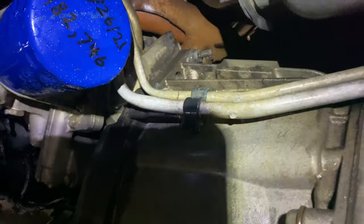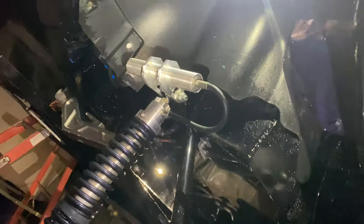Just to be 100% sure I'm going to go ahead and take out this driver's side fender well, because I've been leaking a lot of oil on the driver's side. I'll pull this fender well out so we can get a better look. Now I'm going to continue pulling this fender well out to see if I can figure out where that oil is coming from, and also start running a compression check to figure out which cylinder is bad. Everyone is telling me I pretty sure cracked a piston.